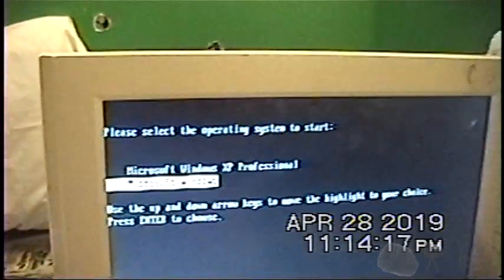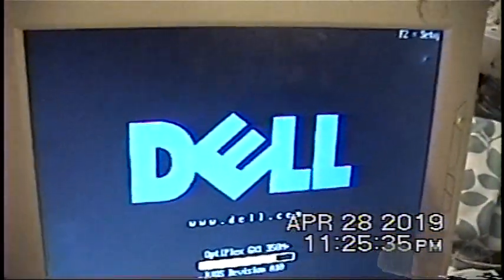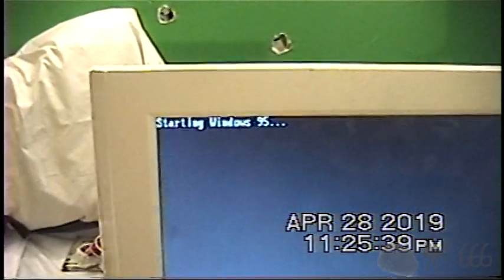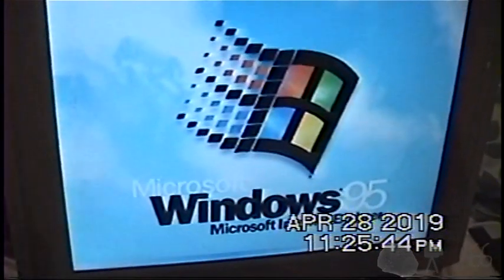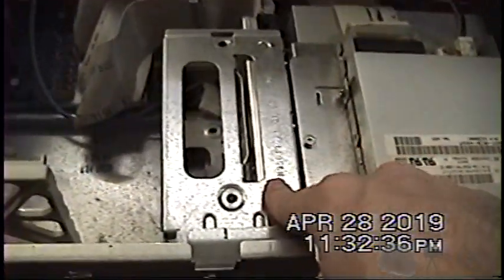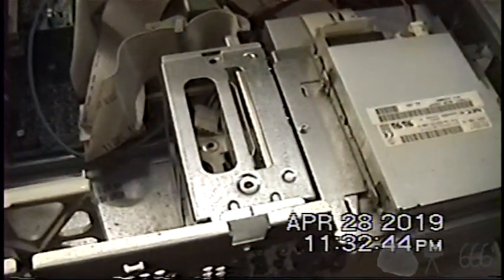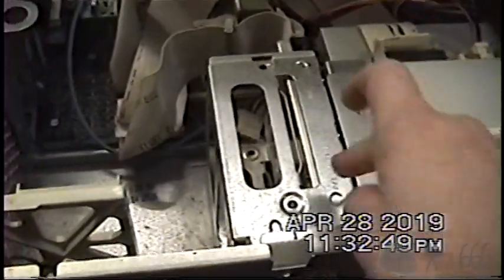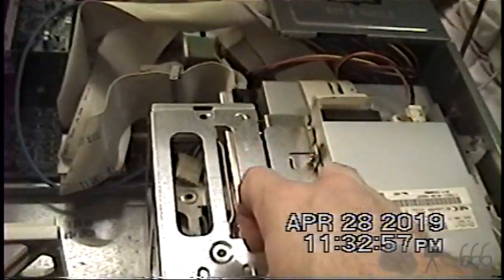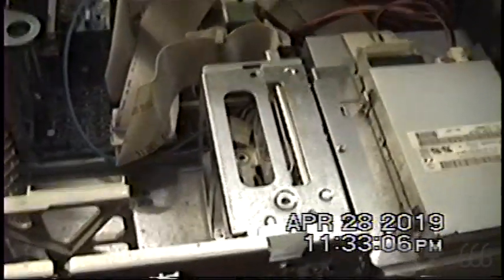I went into Windows XP and changed the boot file on the primary hard drive. It should boot straight into Windows 95. I decided to leave the boot loader configured with a timeout of 0, booting to the Windows 95 partition. One thing I probably should have done earlier is fix the Windows 95 partition to take up the whole 6.4 gigs. I'm probably going to have to do that — and my camera battery is running down, so I'll be right back.